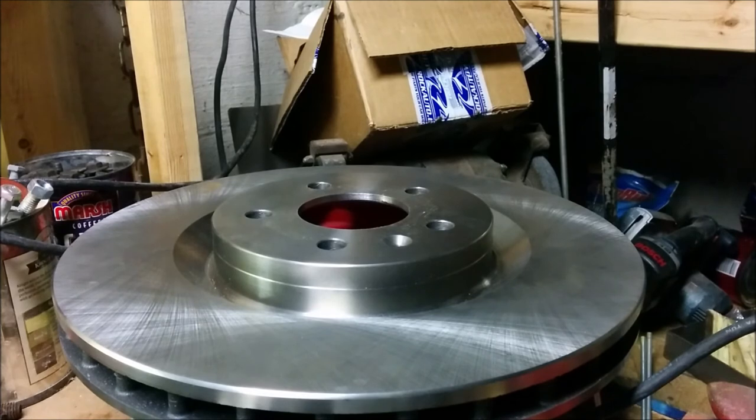This reminds me of a thread I read about putting G8 rims on a GTO — you can use a flush trim router bit to open up the bore on G8 aluminum rims to fit those hubs. It's a really nice DIY solution. Those burr bits, if you want a nice long-life one from McMaster-Carr, are around 25 bucks. A trim router — you could go the Harbor Freight route and get one cheap, or use something like this Bosch. They're pretty inexpensive and handy to have generally. I'm pretty happy with this. That's how I did it, and it's a good way to do it if you don't have access to a machine shop and just need to do a simple brake job.